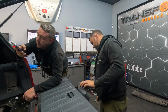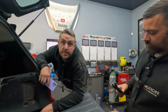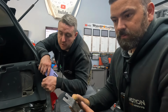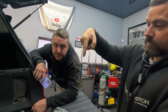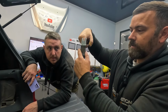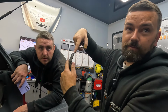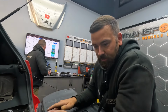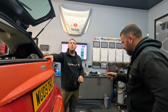So what did he just say? Put a spanner on the crank and just move it, or spin the engine round. When you get the piston to top dead centre and it's on its way down, the piston's being pulled, so that'll have the gap. Push on the top of the piston, and if the big end's gone, it'll drop. See if there's any play there. That's the next thing to do. The complicated thing is getting the screwdriver to the plug hole. Try the spanner first.